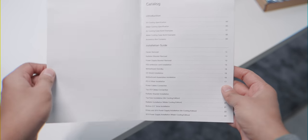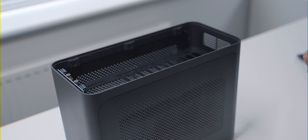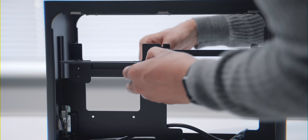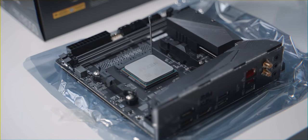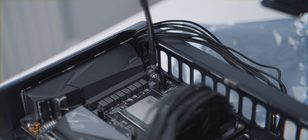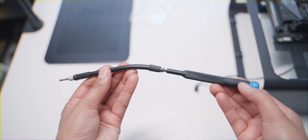Installation was very straightforward and Iconics provide a very helpful manual. You first take off the top cover, which is held in by pretty strong magnets, then take off both side panels, also held in with magnets. Once inside, take off the top bracket, then the PSU mount, and you're ready to put your parts in. Before putting the motherboard in, make sure to install the CPU cooler backplate first, otherwise you won't be able to reach it. I'd also recommend installing your CPU, any M.2 drives, and connecting power cables beforehand. One minor issue is that getting the mounting screw in the bottom right of the motherboard is quite difficult — really only possible with a flexible screwdriver like the iFixit one. Next, you want to mount the PCIe riser cable.